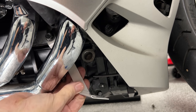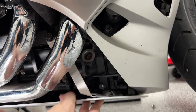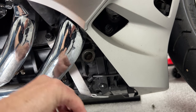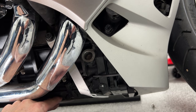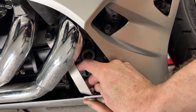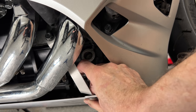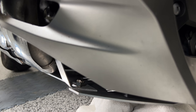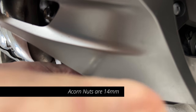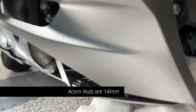It's not completely tight, but tight enough to start manipulating the bracket so it lines up with the carriage bolts. I'll slide the plate forward a little and try to get the acorn nut started on the carriage bolt — if you've got big hands, this could be fun. I was able to get the acorn nut started. I need to tighten it with a 14 millimeter wrench — I initially thought 13 but it's 14.